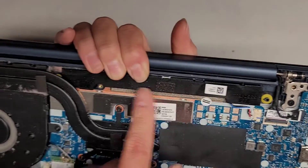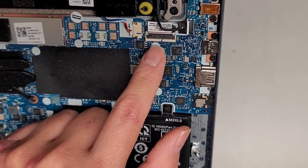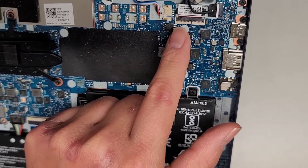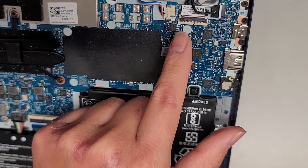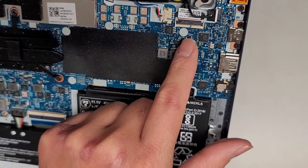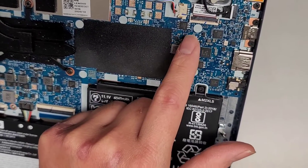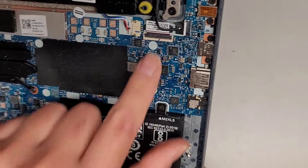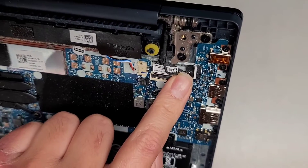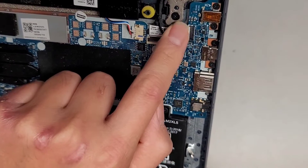You've got the speaker connector here, which connects the speaker bar. You've got the LCD/LVDS connector here — if you're going to mess with this, make sure to disconnect the computer, open up the screen, then press and hold the power button for about 15 seconds to drain residual power before disconnecting it. If you don't do that, you can burn the cable, some circuitry, or even destroy the screen. There's also this cable here — usually it's for cameras and microphones, but it's labeled JTS, so maybe it's the touchscreen connector.